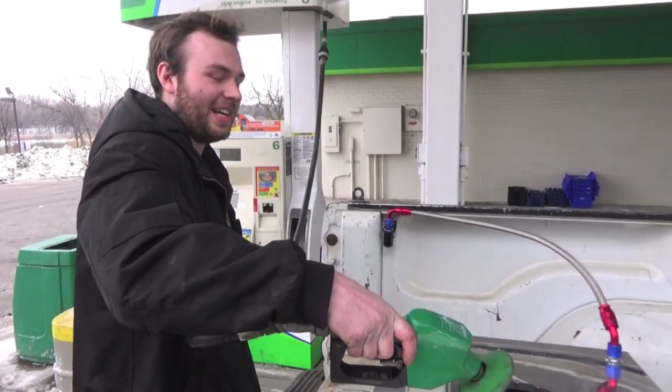This is just because it's winter right now here in Minnesota. Alright boys, we are full of fuel — Whitey's fuel cell is topped off. If you guys saw, we did go wide open throttle and made about three to four pounds of boost. It was really rich, so we definitely have some fuel to pull on it. We definitely got the death wobble out of the front end when we floored it. We just did ball joints and wheel bearings, so I think it's definitely track bar time. We got our wide open throttle data log, so now we can really clean up his fuel and start turning up the boost.